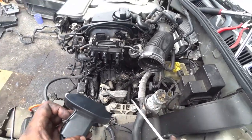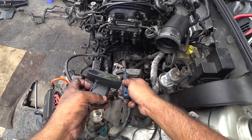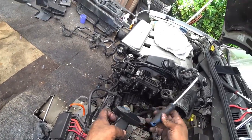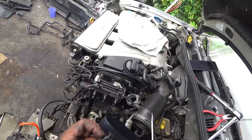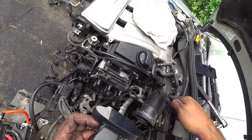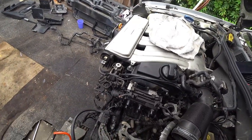That's just all build up — mainly probably because there's a leaky valve cover gasket. It's probably only the valve cover gasket and the PCV system that would cause it. The PCV was also leaky right here — you guys see that grime? That's part of your PCV system right there and it's leaky. That is what causes so much build up.